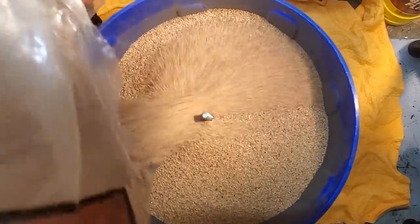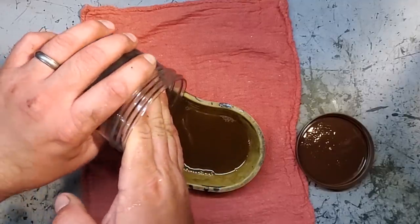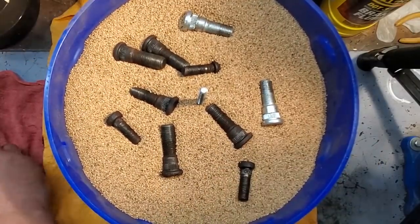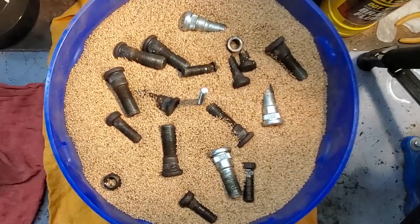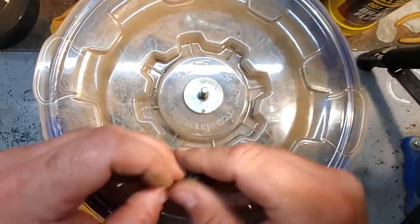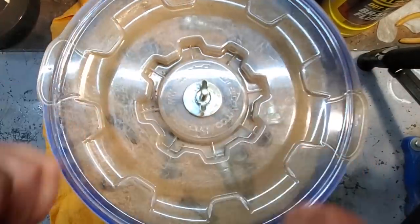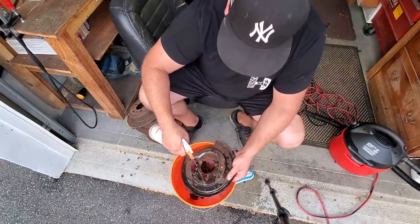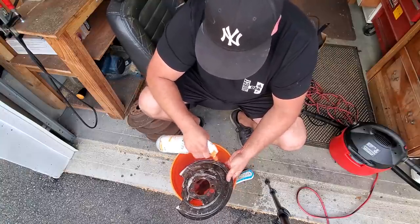When you're freshening up the caliper, make sure you do not grind away these rings right here — they crush on the copper washers and prevent brake fluid from leaking out. Now for our hardware: crushed walnut medium tumbler. We drain out the mineral spirits, dry the hardware really well, throw all our lug studs and backing plate bolts into the crushed walnut medium, tighten down the wing nut, and flip the switch.